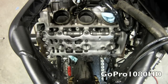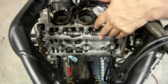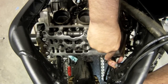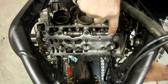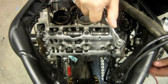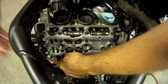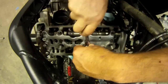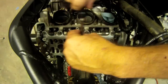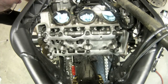I'm going to do the cam ladder here. It needs to be slackened off very lightly, otherwise there's a possibility that this casting will actually crack — it's very fragile. Just start the nut on. They're only torqued down to about 9 Nm, so I'm going to do about a quarter of a turn at a little bit of a time. The bolt's now undone.